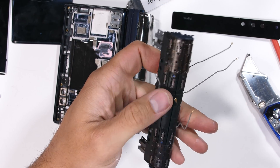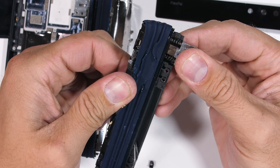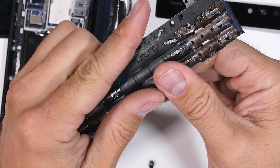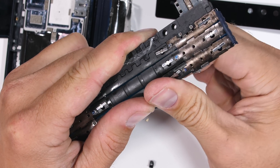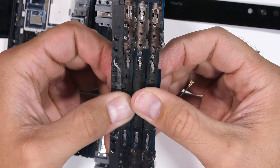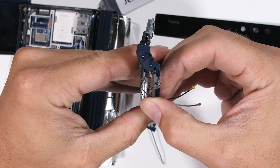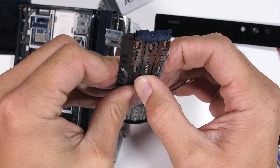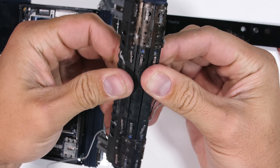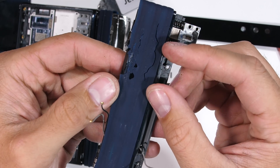I can pull a broken portion of the hinge away from the rest of the phone — this thing kind of snapped when I bent it backwards. It is adhered to the flexible sheet of metal that's under the display, and it looks super interesting: interlocking parts that fold into a U when shut and then expand to lock out into a totally flat surface. It takes a considerable amount of force to bend such a short segment of the hinge. Normally the person bending the phone would hold it from the extended sides, giving a lot more leverage and making the phone easier to fold in half. The hinge is pretty strong. Last year phones felt like they had plateaued, but now there seems to be some cool things in the pipeline for mobile technology. I hope that Royole keeps making cool stuff — I'm definitely a fan.